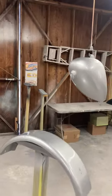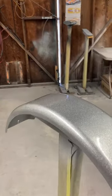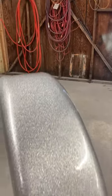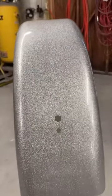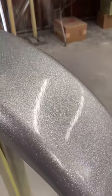What I've done now is cleared these once, sanded them smooth, then cleared them again — it takes several coats of clear to cover up the flake. Now I'll 800-sand these wet and they'll be smooth enough to start putting tape on there. I'll come up with some kind of 60s-type design like he wants — he wants candy red over silver metal flake with some panels and patterns, so we'll end up doing that.